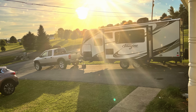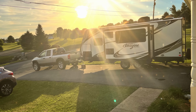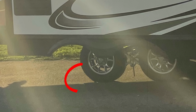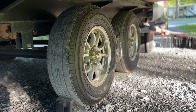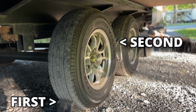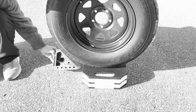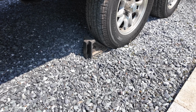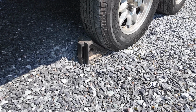I'm outside on my porch taking pictures of our shiny new RV, sitting in our sloped driveway, only to realize I forgot to install my rubber chocks. So they are definitely effective at chocking, but don't do this. Don't use X-Chocks without first using standard wheel chocks. And this can be especially helpful for the situations we talked about earlier in the video. X-Chocks are also peace of mind when camping on loose stone or gravel, where standard chocks are prone to slipping.